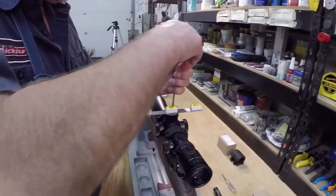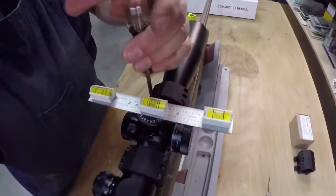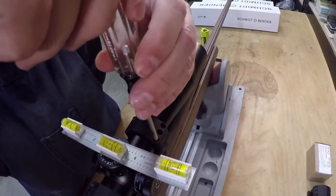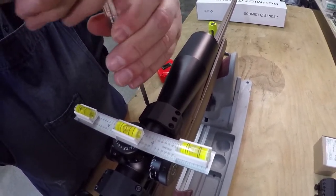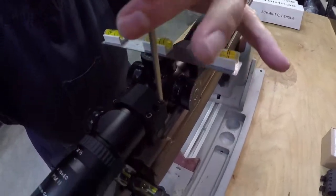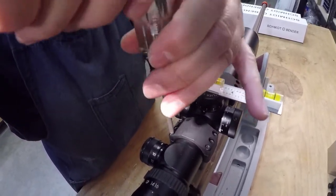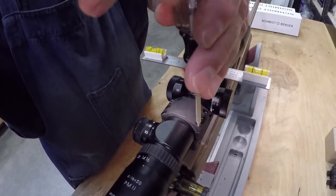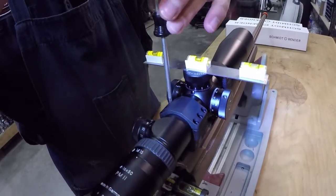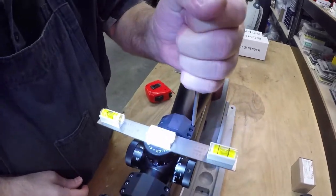All right, now, you do this just like you do the lug pattern on a wheel. I'm gonna tighten that one, and then I'm gonna come over here and I'm gonna tighten this one. And then this one. And then its opposite. And I'm not really cranking them down. This is a better light. All right, now I'm gonna go back. I'm gonna do it over again, give it a little bit of torque.